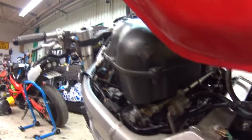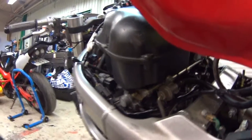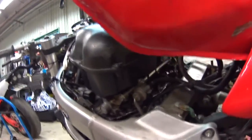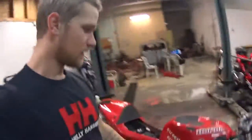This MAP sensor has a little hose intake under it that needs to have vacuum. I'm gonna plug that in and show you guys the difference on the RPM — when it's lowering versus when it should be. As you can see under here, you can see that little vacuum hose going into the MAP sensor. That was the one I had forgotten, and now it's working properly. I'm just gonna put the tank down and show you the difference.